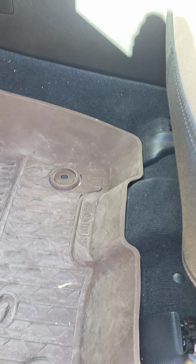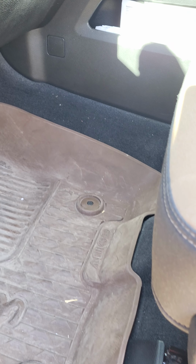If you feel like you got everything tuned in, and I apologize for not being able to show you the dials on it, but most of y'all have tweaked with stuff like this before, or else you wouldn't probably be looking to do this. There is also a switch that flips the way the sub hits, in or out, to give you the last little final step in trying to clean up the bass. In my situation, I left it on normal, but you can actually 180 it and have it firing in to clean up bass, and I understand the need for that too, especially in tight spaces.